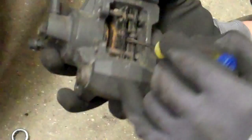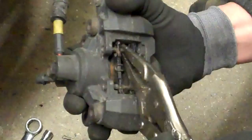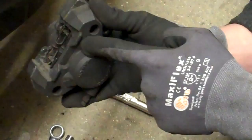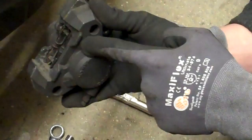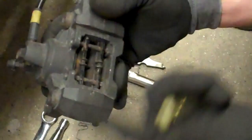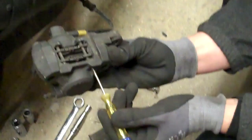What you can do if you're extremely lucky is get a pair of mole grips on that pin, rotate and wiggle it, and it will come out. But I have never in all my 30 years of motorcycle riding managed to get one of those out. It's a blind hole on that side — nothing to get that out at all. So the normal garage way is to get a little disc cutter, cut the pin, bend it forward and pull the back out — you effectively destroy the pins. But there is a way of doing it, and that's drilling the caliper. You pop the drill bit through the blind hole and tap them out from the back. Let's get the drill ready and I'll show you.